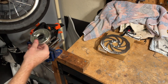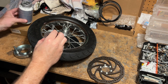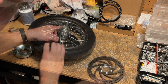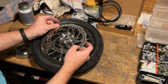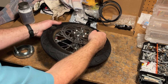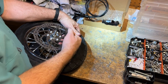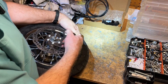There you have it. Now I have those threads exposed. This is the old drum brake. Now I'm going to install the new one on here. Before I thread that on, I'm just going to add a little anti-seize on here — you don't have to do this, I just like to do this so I can easily take things apart and I don't gall the threads. Now make sure your bolts are out and then thread this on. You want to make sure the threads are all the way down.